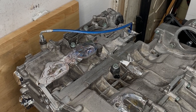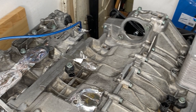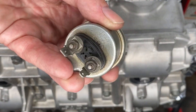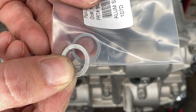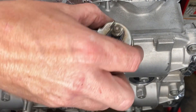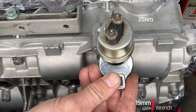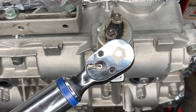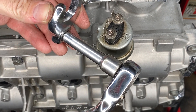The oil pressure sensor is next. On bank one we just installed the oil feed for the direct oil feed IMS. On bank two is another orifice for the same sort of thing — and what goes in there is this oil pressure sensor. I did get new O-rings for that; the new one is quite a different design, smaller in every respect. We're using a 19 mil to torque it to 25 newton meters, but we can't fit a socket over it obviously, so I found this adapter in the bottom of my tool kit. Now — does that give you an accurate torque reading, and if not, how are you supposed to torque those things? Let me know in the comments if anyone knows.